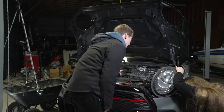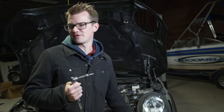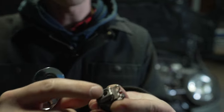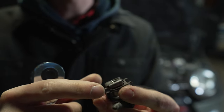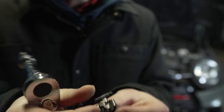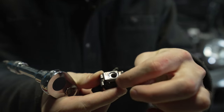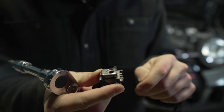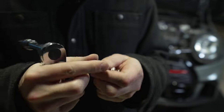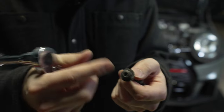We've come to a little problem. One of the bolts down here is actually fused — it goes through here and into a square bolt behind the panel. The problem is the bolt is fused to the housing, so when you turn it, it just spins freely. We can't get any pliers in there because of where it is, so unfortunately we're going to have to take a grinder and cut the top of the screw off so we can get it out.